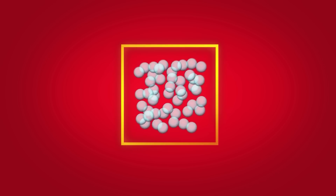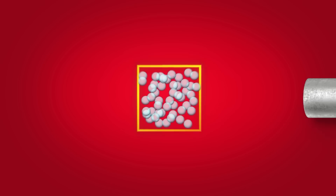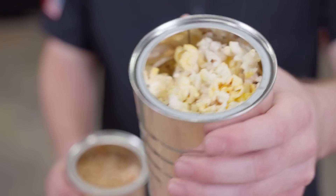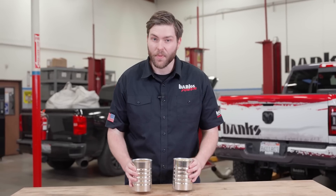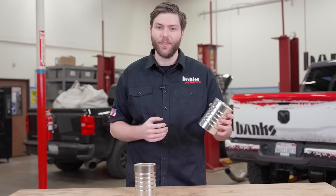Air density is the foundation of mass airflow. To get the mass in mass airflow, you need to know the air density and therefore its weight. Apply that mass over time and you get the flow rate. Let's imagine these two coffee cans as two cylinders of an engine — this one is full of popped popcorn, while the other one is full of unpopped kernels. While they technically have the same content, thanks to these kernels being popped by heat, they're now less dense. The same thing happens with the air in your engine. As air heats up, it expands and becomes less dense. But as air cools, it becomes more dense and contains more oxygen in the exact same volume. And with that, we can add more fuel and create more power, thanks to our increased amount of oxygen.